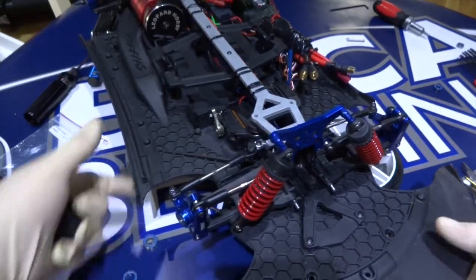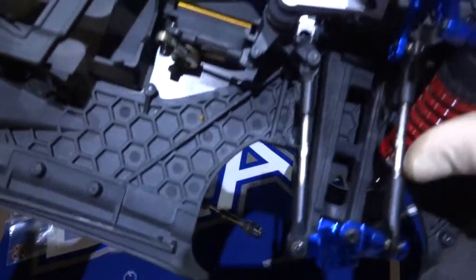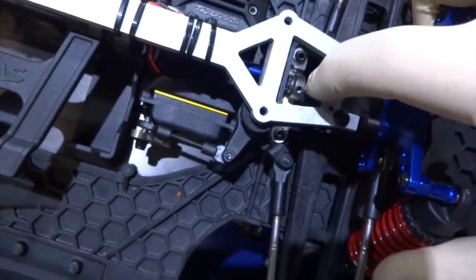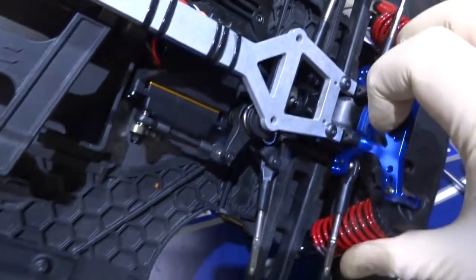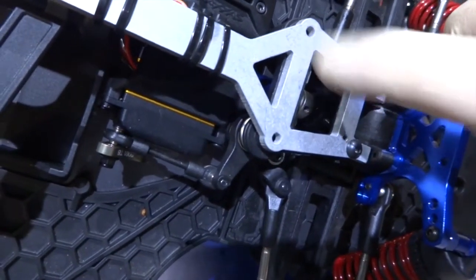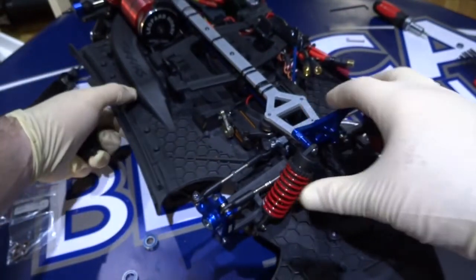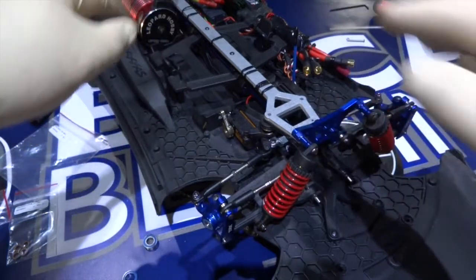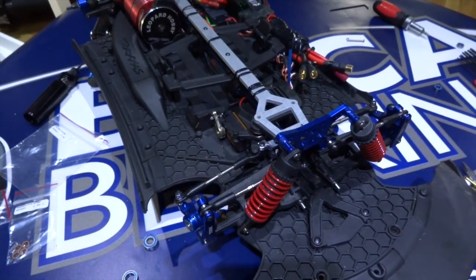And you want to go ahead and remove the pin for the center drive shaft that allows this to move a little bit further up. Then with that pin removed, you can take the bearing out just by pushing it that way. Saves you a lot of time. You don't have to necessarily pull it off, although we are going to have to pull most of this car apart. So don't think this is just some easy thing.